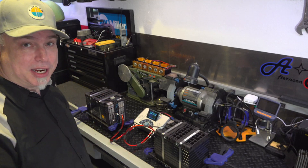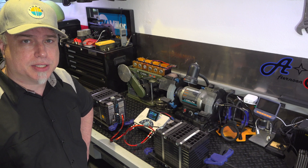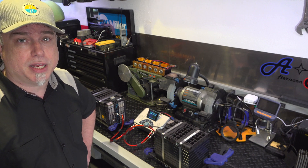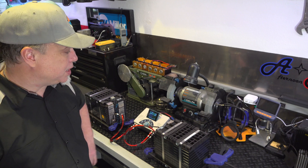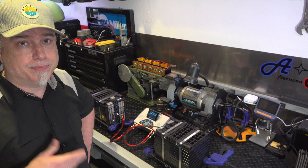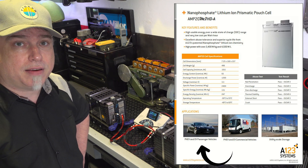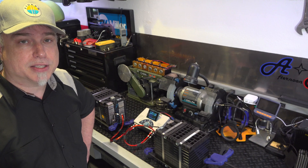You can see how much effort it is to test these batteries. Two hours a cycle takes quite a long time — it's probably going to take me about two weeks to test them all. And did I find anything? Of course I did — found something definitely incorrect, something that was broken. You'll have to wait until next week to see that. What I'm going to do is tear one of these packs apart, open it up, and see what we can do about repairing it. I've also had a hard time sourcing replacement batteries — most come out of China, and they have to match the same specifications as the one that went in the car. Next week we'll go into battery repair and work on getting this whole thing back in the car, take a drive, and see if it fixed the problem.